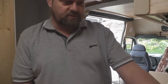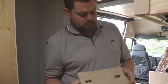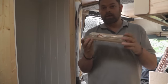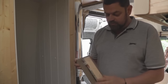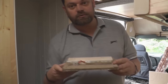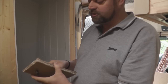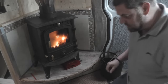A little homemade creation I've made myself is an internal light for the bedroom. What I did was cut myself a piece of ply, coated it with hessian and carpet over the top, glued it all down. Then I put a piece of 2-by-1 planed timber, attached the LED strip to it, put my connector block there so I can connect it, and then I'm going to screw that to the bedroom ceiling so it keeps in keeping with the feature of the rest of the bedroom.